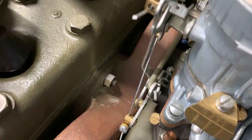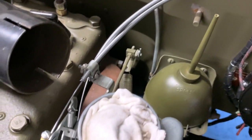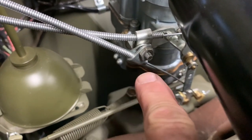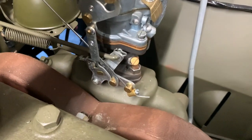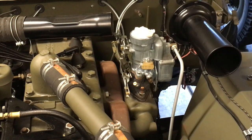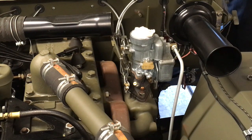Okay, so we've got everything hooked up. Let's take a nice close look at it. I am missing that linkage by about a sixteenth of an inch — you don't want the cable impeding the movement of any piece of that carburetor mechanism. Notice how I've got that clamp on a downward angle so it makes an arc on the throttle cable — keep that in mind when you're setting it up so they don't interfere with the operation of your carburetor. I'm going to leave that rag in the carburetor; I don't want any debris falling in while I'm working on the Jeep. Now I'm going to go ahead and test my throttle cable multiple times — pull it back and forth, halfway adjust, quarter-way adjust, up and down. Make sure nothing's dragging and it doesn't stick open or closed, because that could cause you a big problem. Everything seems to be secure and everything seems to be working fine, so we're going to move on to the next step in the restoration of the 1943 Willys MB.